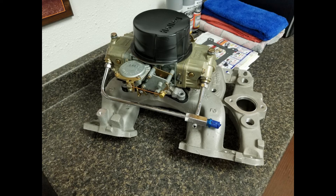One thing I'm tossing around in my head: since the intake manifold plenum has been clearanced for a square bore flange, I'm thinking about welding on the intake and building it up so there's enough material to drill and tap for a square bore Holley flange. If I did that, the intake manifold would be a universal intake — you'd be able to use it with a Quadrajet, throttle body fuel injection, or a traditional square bore Holley carb. I'm not going to bolt the intake on the motor until this winter, so it's something to think about.